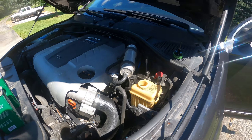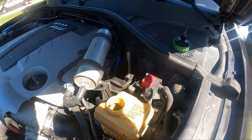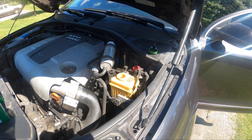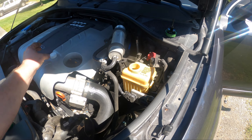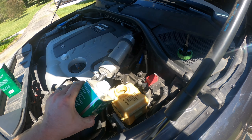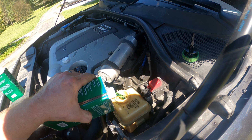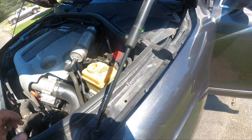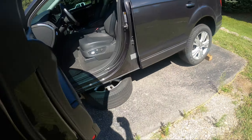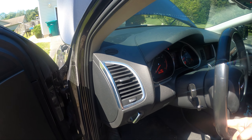Here's my plan - since I don't know any better, I'm going to get fluid in here and then turn the rack left and right without the car running, just to see if I can push any air bubbles out that way. Then we'll run it and see how it sounds and see if anything leaks. It's a little overfull but we'll turn it - remember our tie rods aren't connected, so this should be center right there.